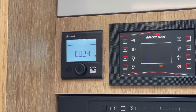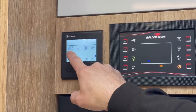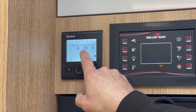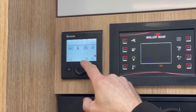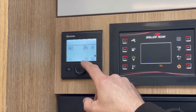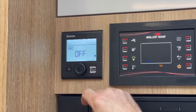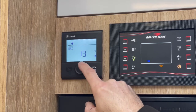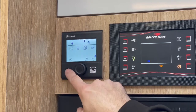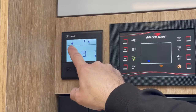Your heating and hot water is controlled from this panel. Whenever you want to do anything, just press the button in the center. Across the top we've got heating, hot water, energy selection, and fan speed. To go into one of the options, just turn the dial until it's flashing. To adjust the heating, turn until it's flashing on heating, click the center button, turn the dial to the temperature you want the van at, and click again. When we go back to the main screen we can now see that we've got the heating running.